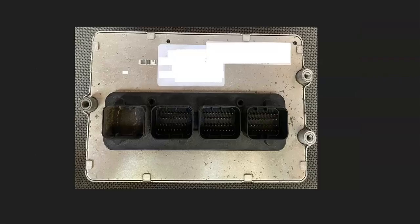The last thing that could cause this problem, if you've checked everything else out and it all looks good, is that the onboard computer — the ECM or PCM — may have failed. This is fairly rare, but it can happen. If it were me, I'd go back and double-check the wiring and the knock sensor really well before concluding it's a failed PCM.